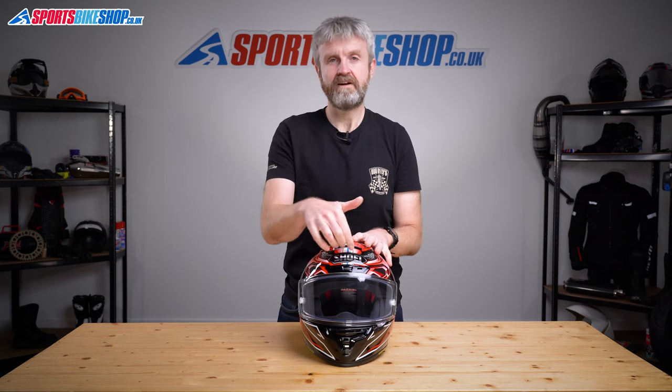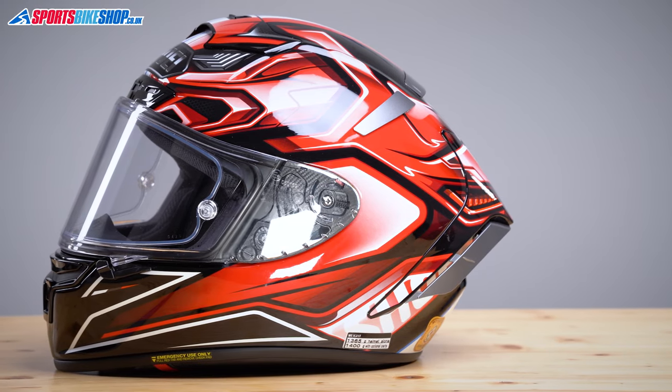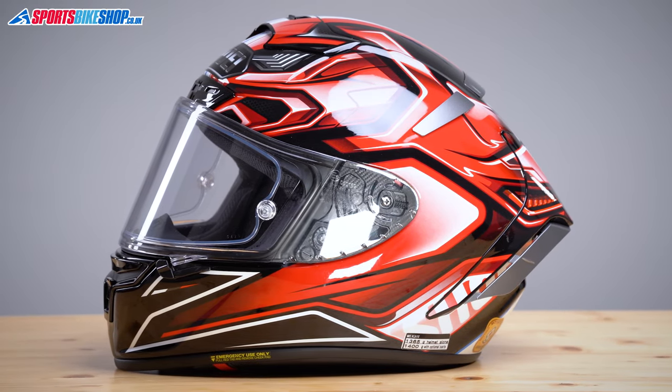When I said these vents are dual action, that means the air coming through doesn't only travel directly through to your skin on the inside. Shoei say that direct flow of air does cool you down a bit, and it's reassuring to feel it, but the cooling effect is limited. When a lid fits tightly, it's harder for air to circulate through those channels in the EPS impact liner, which causes it to heat up. Shoei's solution is to direct some incoming air through channels between the shell and the EPS liner, which cools down the EPS and reduces the overall temperature inside the helmet.